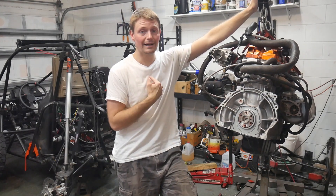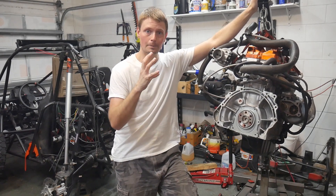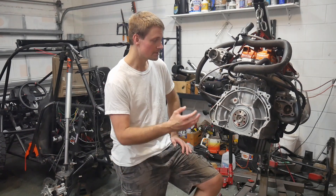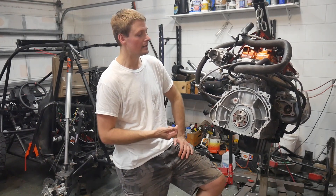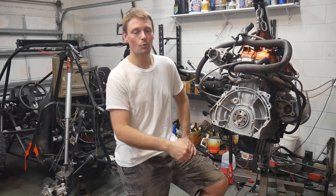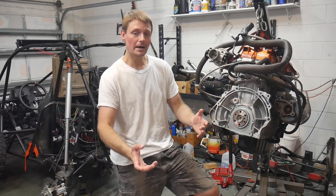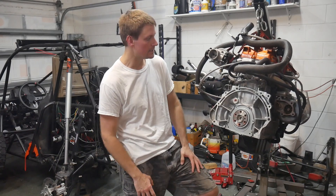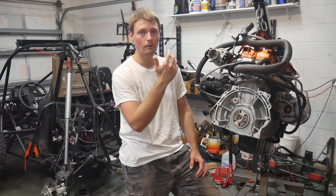There is one thing my clutch guy can do that I don't have the ability to do, and that's to balance the clutch basket. I didn't think it was going to be a problem at first, but having added so much additional weight with the extra spring in that basket, it really should be balanced with the rest of the system. Based on my testing and a little run-in we've done so far, it does appear the engine is now better balanced than it was from the factory — if that's even possible. I figured factory balance would be as precise as you could get, but we had to add quite a bit of weight into the system to get it to balance. So you'd think having that additional moving mass the engine would vibrate more, but I don't think it does. I think the engine is actually better balanced now than it was previously.